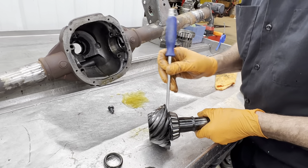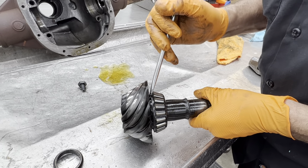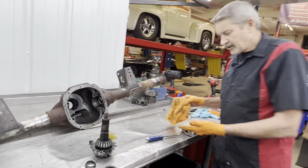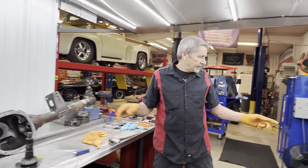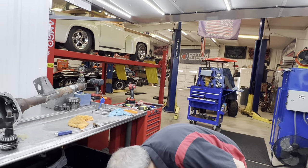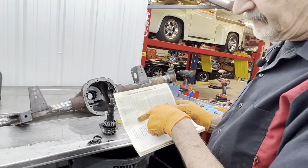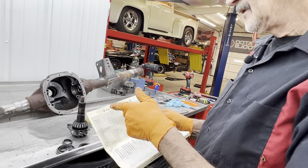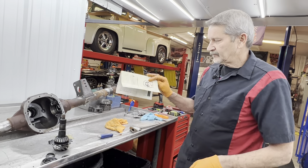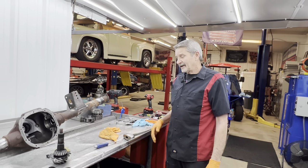When I take this apart I'll figure out what gear ratio it is for sure. I will mic that selective spacer and then go to my book and make sure that is the right spacer behind that gear. It tells you which one the factory comes out with. So if you're going from a 3.42 to a 3.73, you can start out with the shim right here. This is a really good book — only one in the world that I've got.